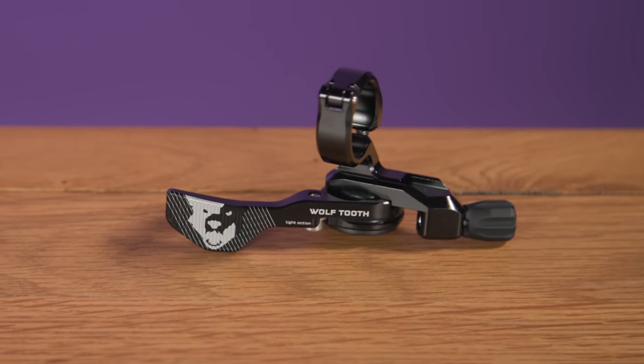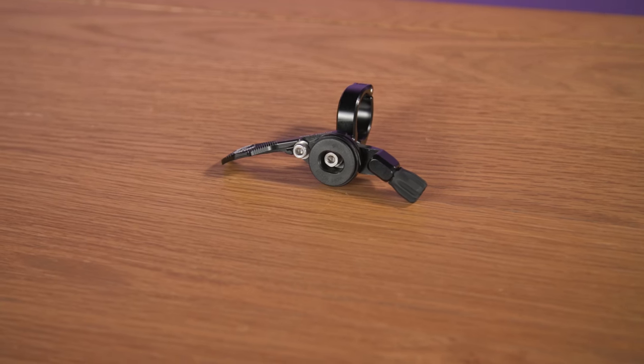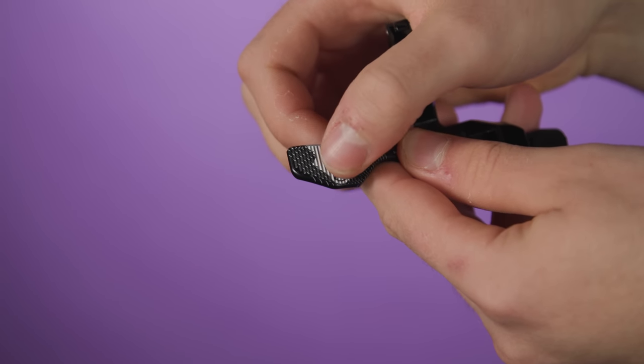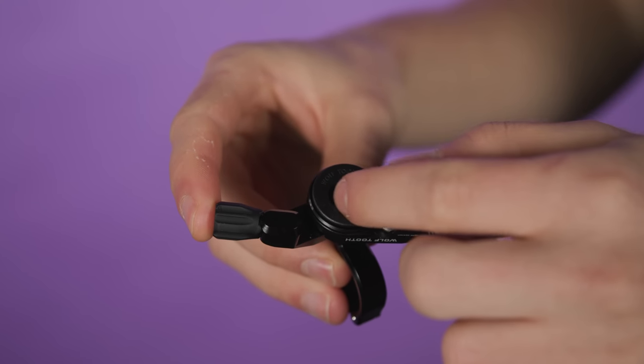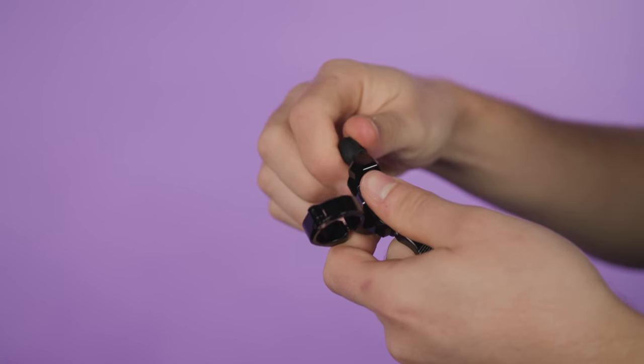The lever is often the Achilles heel to a dropper post assembly, and Wolftooth's simply named Remote Dropper Lever has proven a transformatory upgrade for my Norco Optic. I'm seriously impressed with the lever feel and construction. It's compatible with all cable actuator dropper posts, and the remote allows the cable head to be housed at either end. It proved remarkably easy to install. The remote's lever uses a textured grip and a 21mm sealed cartridge bearing for silky smooth action. Crucially, there isn't an ounce of play, which is something you'll find on the majority of levers. There's a machined path for the cable routing, which extends to the custom pinch bolt to clamp the cable and prevent any damage. Even the barrel adjuster is well designed and offers a satisfyingly smooth action. Wolftooth says it has engineered a failure point, allowing the lever to break away from its base in the event of a crash.